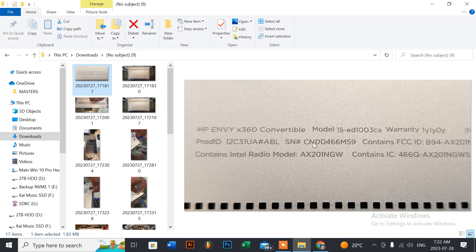He initially called me without bringing in the laptop, so I ordered the fan for this model. One company was selling it as a dual fan piece — some models have a left and right fan, one cooling the GPU and one cooling the CPU. Since I ordered the dual fan version, it came with the proper fan I needed for the right side; his left side was actually bare, as you'll see in the video.